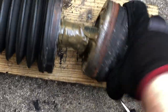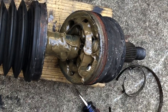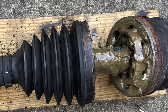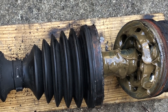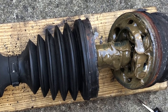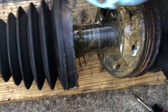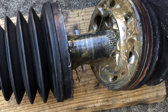There's a ton of grease that we're going to need to clear out of the way. What we're looking for is the side that has the snap ring. We're going to clean that grease out of the way so that we can see that snap ring, and then we're going to use a snap ring plier to open that up so that we can separate the two pieces.